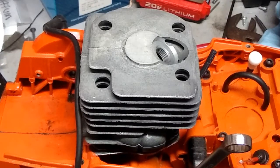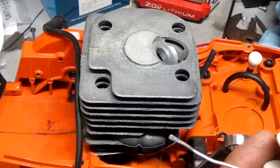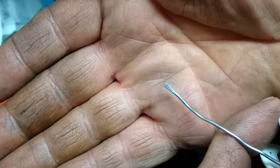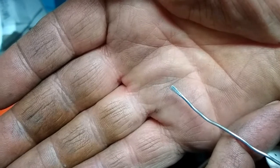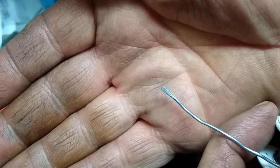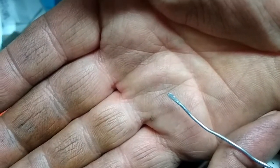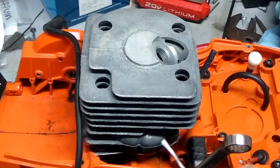I've got the cylinder cleaned up and mounted again — we're going to find out if this experiment was an epic fail, and I believe it was, but it was worth a try. Going from the previous measurement right there, and going right near the very edge at the end of it, I'm getting right around 26.5 to 27 thou. I've got a feeling I didn't change anything.